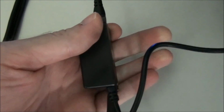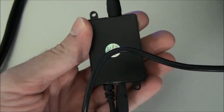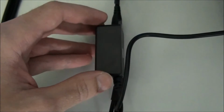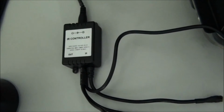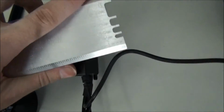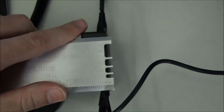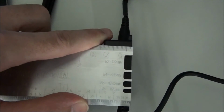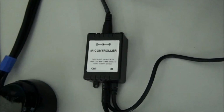And I'm just going to turn it around, give you a look at the back. Something else that could be a little bit of a problem with this controller box: some cases only give you maybe 15 millimeters behind the motherboard tray. And that is kind of a bare minimum. But this controller box is 20 millimeters high. Okay, so just something else to take into consideration.